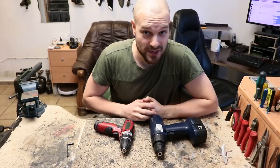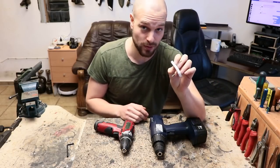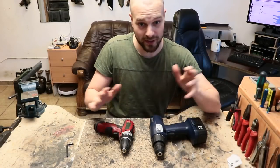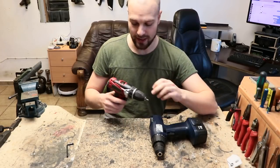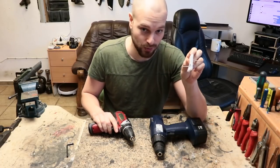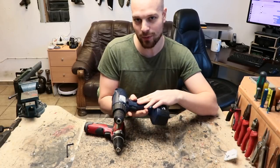Welcome to the Nucleus Snail channel. I recently purchased a new cordless drill which I actually use more for setting bolts — three millimeter bolts specifically, which I use in almost all of my creations — than for actual drilling. I've encountered this problem no matter which brand of drill I tried: even in the fast, low-torque gear on the lowest setting, it would still provide so much torque that it would strip my three millimeter bolts.